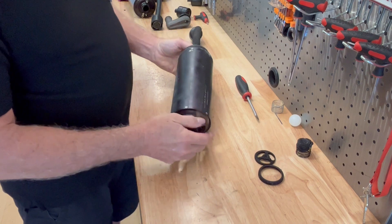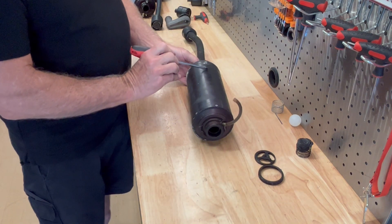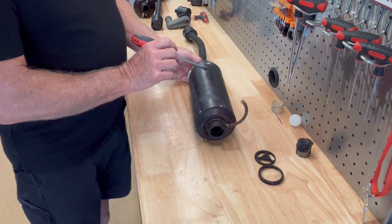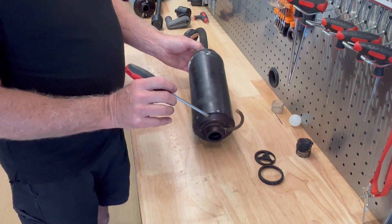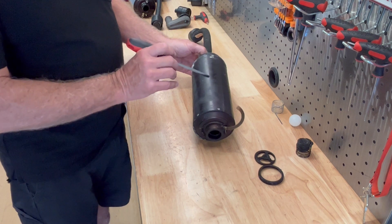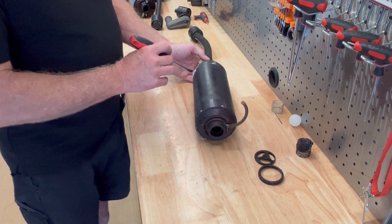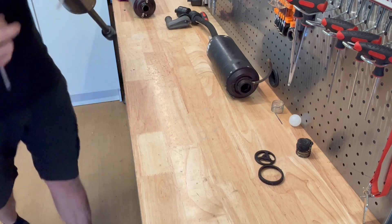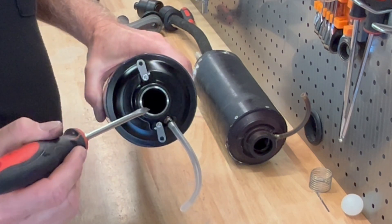You can hear this one rattling inside. Inside the tube there's an internal tube that runs up to about the midpoint, with a baffling system inside. These internal tubes corrode off and break, which first blocks up the pipe with aluminium debris from inside the exhaust, and second, it changes the tune — that particular internal tube length gives the engine a specific power band. When it starts breaking off, you start losing engine performance, and the aluminium fragments floating around inside cause further damage.